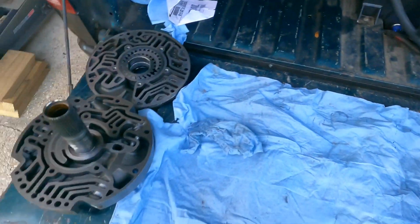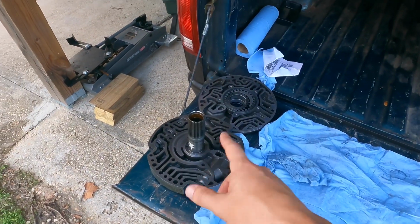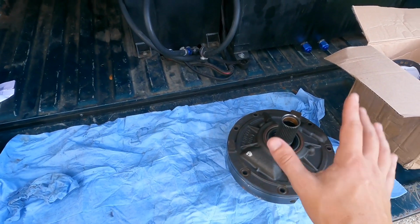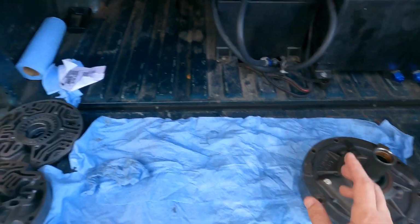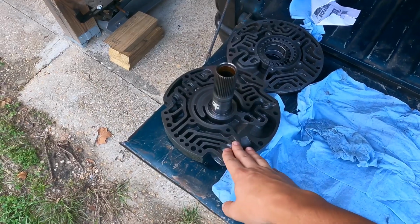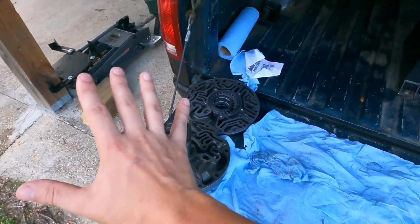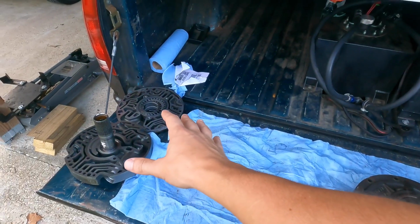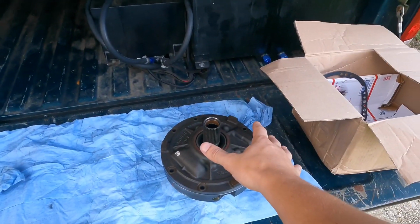We got that one taken care of, but there are a few things in this pump that we need to put over here. So we've got our new Sonnax line to lube valve and some other things to help the torque converter on this side. But on this one, we need to get our boost valve out, a couple of the shims, and then our torque converter regulator valve. We had some things done to those that we want to get swapped over to this one. I had just forgotten this old and busted one whenever we assembled the new hotness.